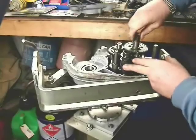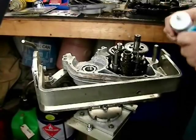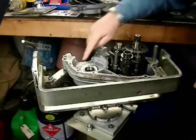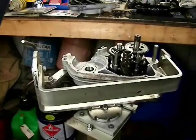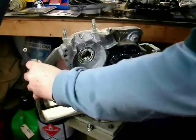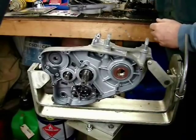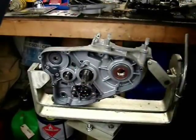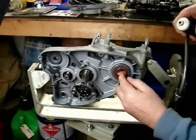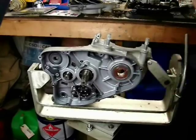I lubricate the crank bearings with white lithium grease — this gives the engine a nice clean startup when everything's brand new. You will be smoking for a few minutes when you first run it. I prefer silicone grease on the seals; put it in the lip and it lets the seal break in nicely. Some of these tricks I learned from friends in Spain — older gentlemen, some no longer with us, some long retired. I make these videos because someone needs to pass this information on before it's forgotten.